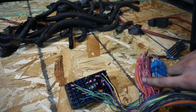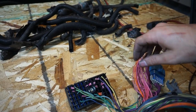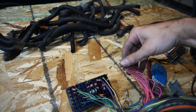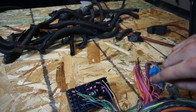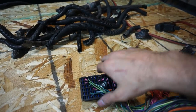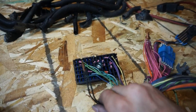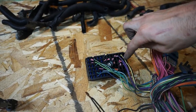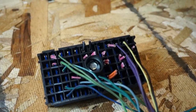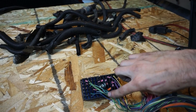This bundle of wires - these are all going to 12-volt sources. There are two orange wires that are PCM power continuous sources going to battery constant, and then all these pink wires are 12-volt ignition positive sources - they power your coil packs and injectors, every single one has an individual wire. These were all cut off this plug. There are also two grounds that I cut off, and all the 12-volt pink positives are in a bundle here along with the two orange wires.